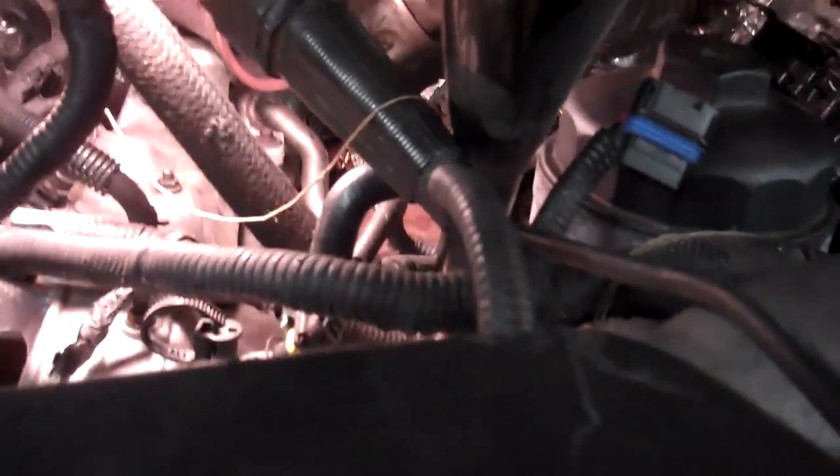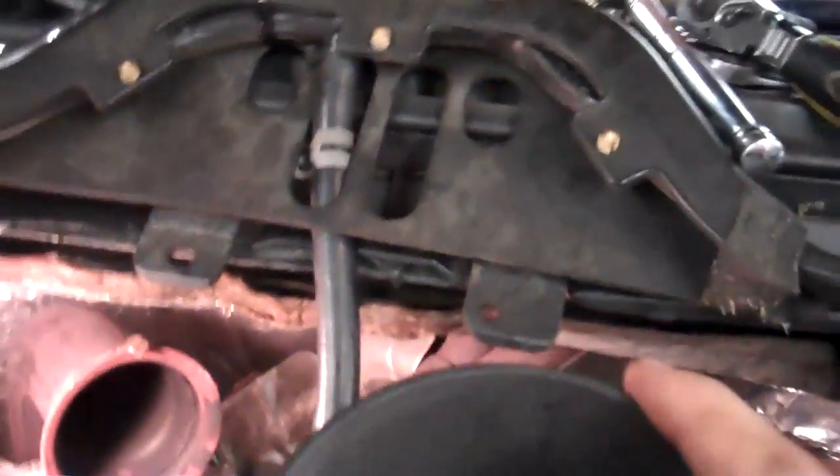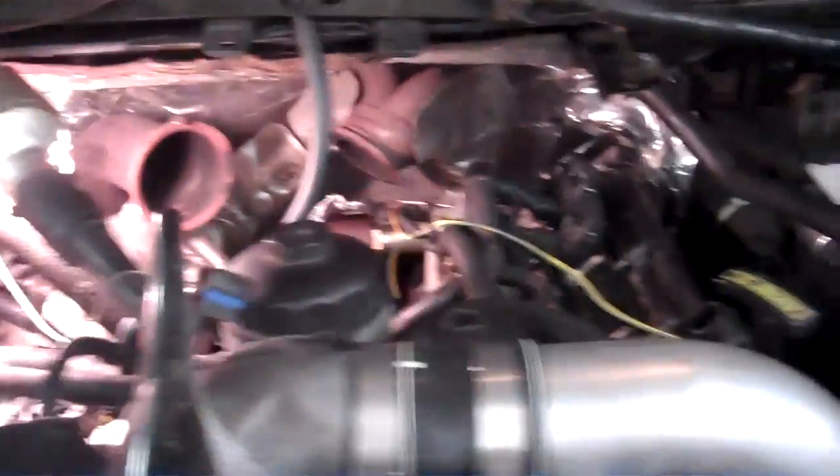I'm also going to listen to the turbo drain back — actually that's a supply line hole. I don't hear any noise coming out of it. I heard noise there before last year, and it was my high-pressure oil pump that had failed. But now you can hear air coming out of the turbo drain line, which means probably one of my tubes in there has lost its ability to seal.